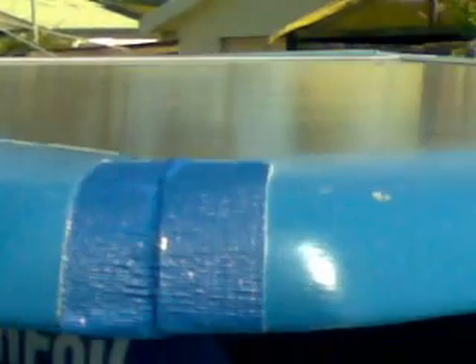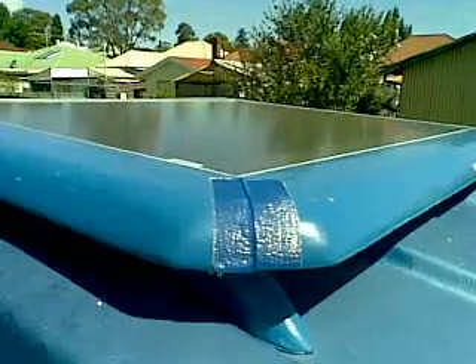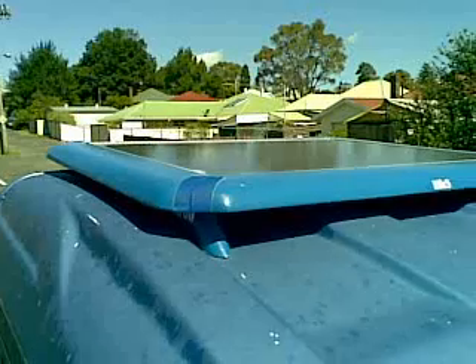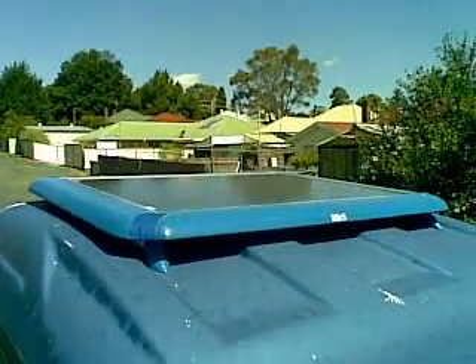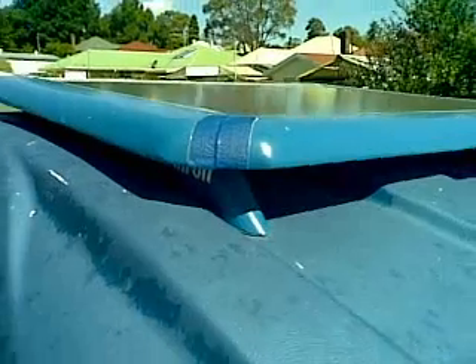Over here on the Mark V — a 30-watt panel on the turbocharged intercooled diesel Rodeo — the 100-mile-an-hour tape is holding up well. There has been a little bit of damage from hail, but nothing worth seriously bothering about. We've proved a couple of things: one is that you need the biggest panel you can fit on a diesel — 30 watts is not enough. The other is how slowly your battery responds to being fed supplementary electricity from a solar panel, and how fast it responds to losing the solar panel. Have a look at this.